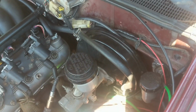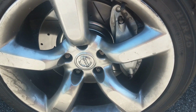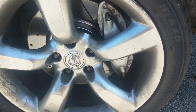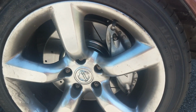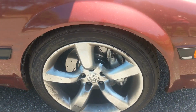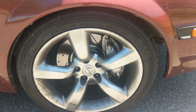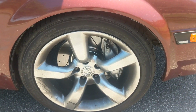It's a small brake booster. These rotors are actually new. They're drilled and slotted 350Z Brembo track pack rotors, 12 3/4 inch, with CTSV Brembo front calipers. They're 4-piston. They're pretty big. They even make adapters for the S13 to fit the 6-piston calipers, but they're way overkill for most people. I mean, these stop pretty damn good. It has the CTSV BrakeSwap.com S13 adapters to mount those calipers on the Z31.